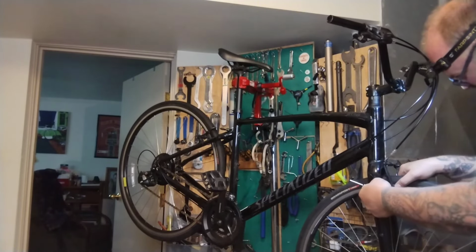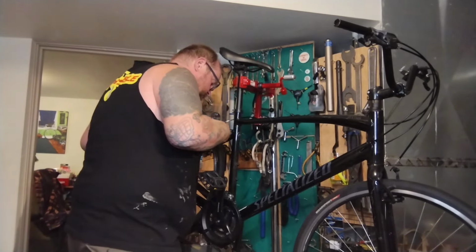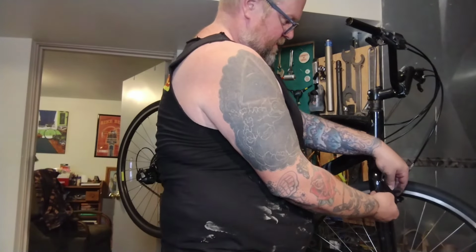Bad brake adjustment. Before I do that, I'm going to take a closer look at these backs and make sure they're not all totally worn out too. No, these are fine. The front was set up way, way, way too low, so they're all super worn down. Let's take a look at them. As you can see, they're almost new on the bottom and the backs. They're adjusted so bad that the top's completely worn off.